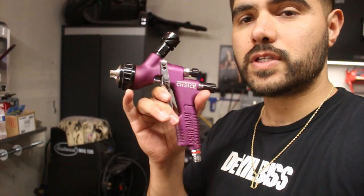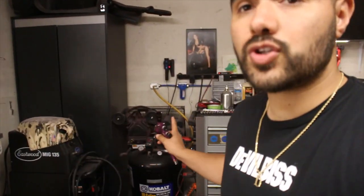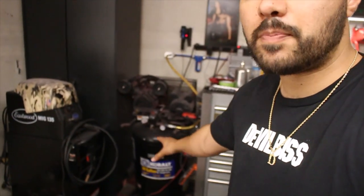I get a lot of questions about how I'm using pro guns with such a small air compressor, and that comes down to storage amount. You want to make sure your air compressor has at least 30 gallons of capacity — anything less and you're really going to struggle painting anything. With larger spray guns, I tend to pick guns that are high transfer efficiency. They normally require less CFM than HVLP spray guns and tend to atomize the paint much better, giving me much better finishes.